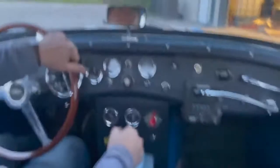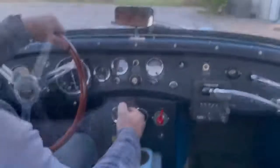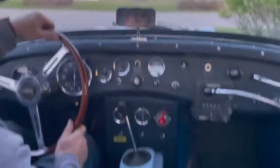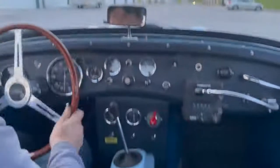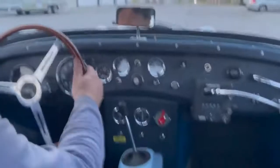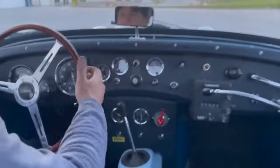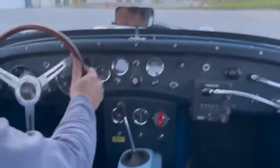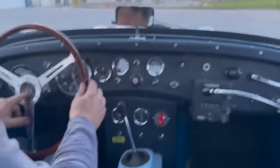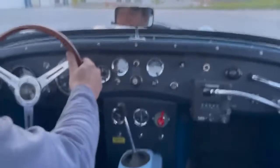It's a big mess in the shop right now because there's a bunch of stuff that we're kind of going to be taking out to California. The steering wheel's not held in right now, so I need to make sure that we're driving straight. The brakes do work. So now I'll take the steering wheel off and center that, then put the nut on — then I know that the alignment is right and the steering wheel is straight going down the road.